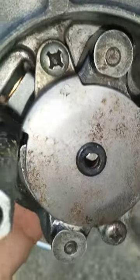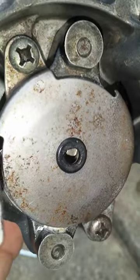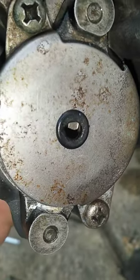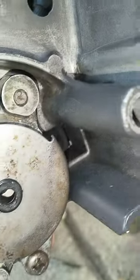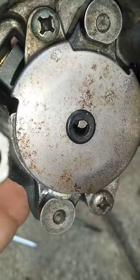The rod is 6mm, the hole is 9mm. That was leaving too much of a gap for stuff to get by, so I have put a small grommet in there. It doesn't affect the movement of the rod at all and it should keep it cleaner inside.